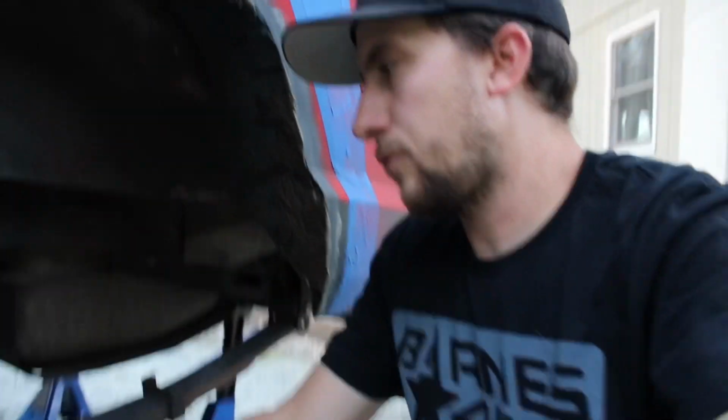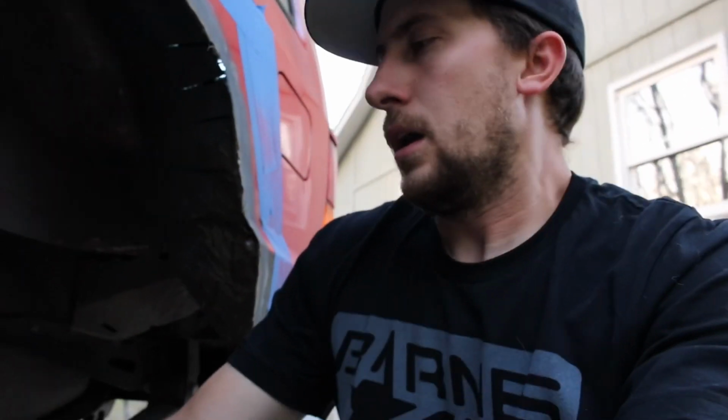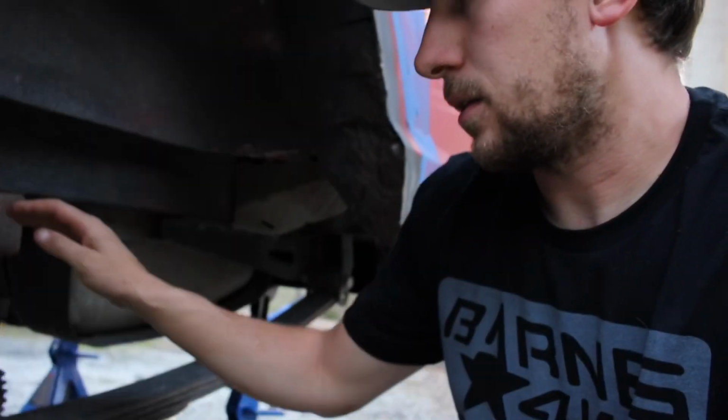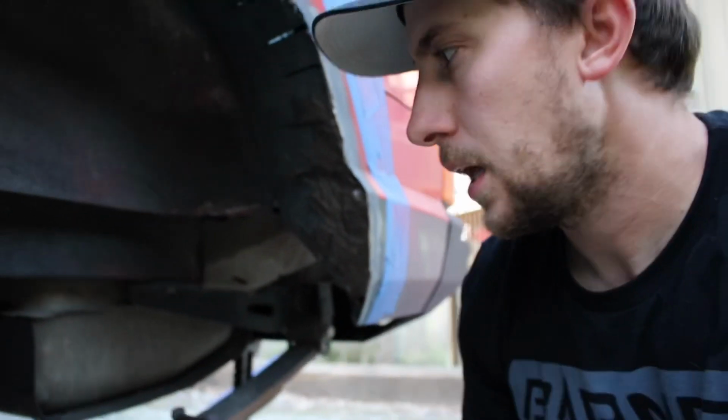So what you order from Barnes, you can obviously call them. They're extremely helpful. I called them and they got me everything that I needed. They knew exactly what I needed for the kit. I bought the perch plate for it, and then the U-bolts, and then the leaf pack plates, and the shock mount kit. That's all you need for the rear axle on these, if you're keeping leaf packs.